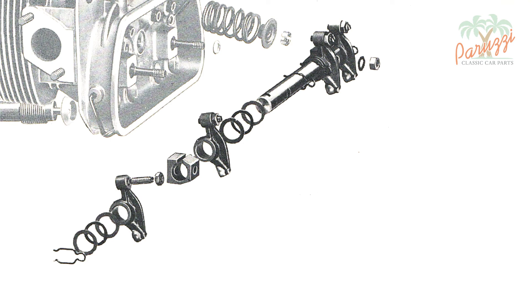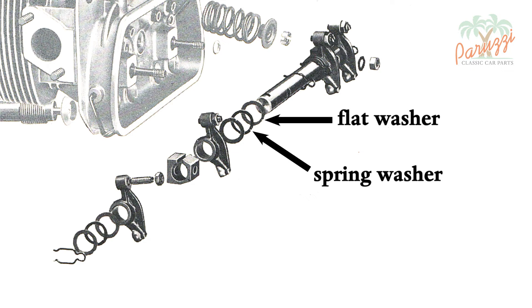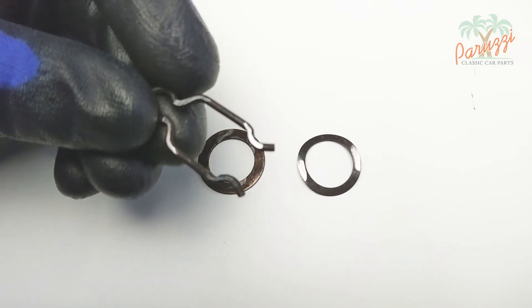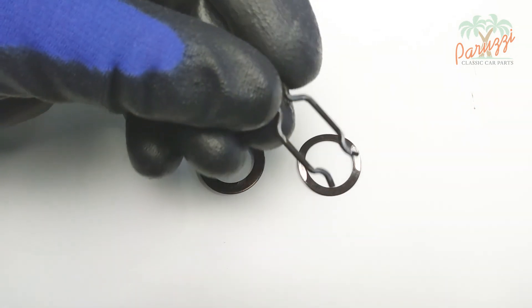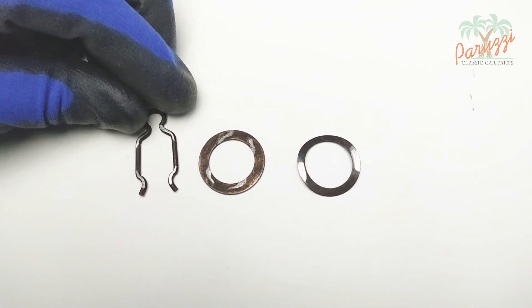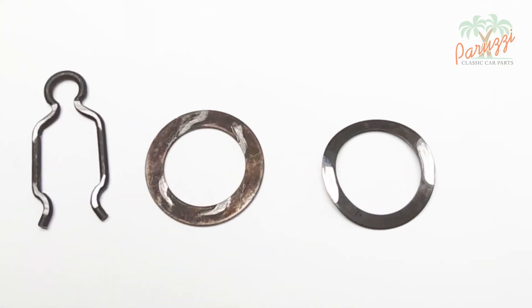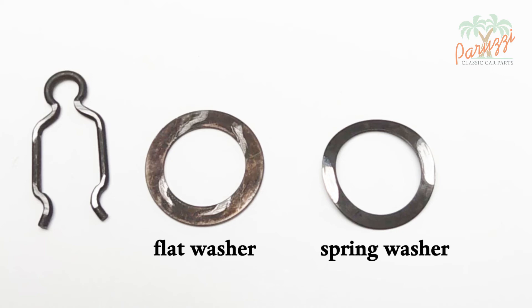You would not think it immediately, but the mounting material is also subject to wear. When the oil pressure decreases, or when the engine oil is not changed in time, the flat washers, the spring washers and the end clips will also give up at a certain point. Here you can see an end clip with obvious wear caused by the pressure of the flat washer. This end clip has lost its clamping range — if the clip breaks, the rocker arms will come loose from the rocker shaft, resulting in engine damage. The flat washer and spring washer also have obvious signs of wear, which will seriously affect the axial play of the rocker arms and may prevent the valve stem from rotating as it should.